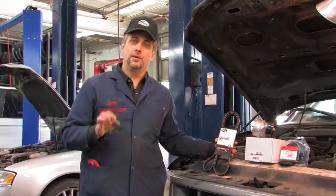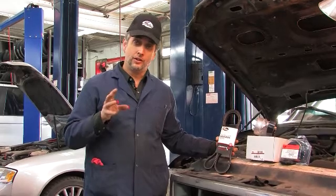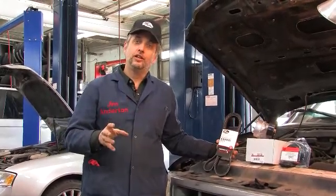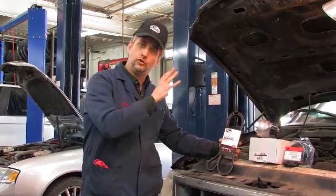This vehicle has a rotating electrical problem, specifically an alternator issue. We're going to change the alternator. However, to get to the alternator, we're going to remove the drive belt. The alternator can't produce electricity if it's not being spun reliably by the engine — this, of course, requires the drive belt system.